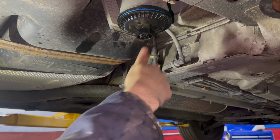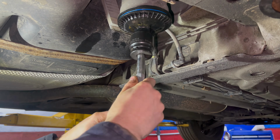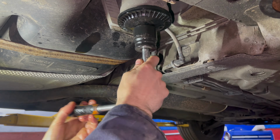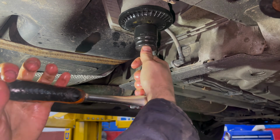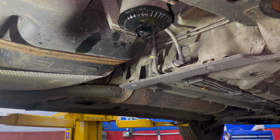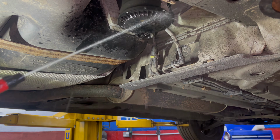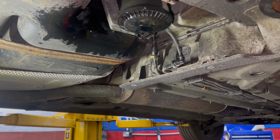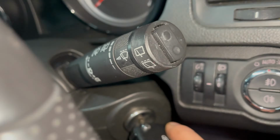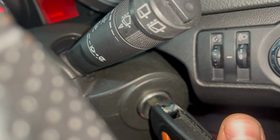Now it'll say 25 Newton meters on the housing once again, but with these plastic housings you can always tell as soon as the plastic meets, then the housing is tight. And we'll just clean off the excess diesel. So when I do fuel filters, if we're lucky, we'll get away with just cycling the ignition a few times, which initiates the lift pump in the tank.